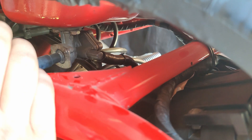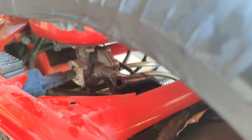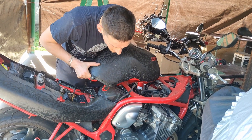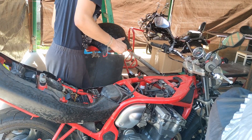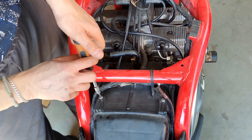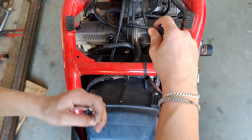Okay, took down the vacuum hose. Now let's take down the gasoline line — hopefully it will not spill tons of gasoline. Hopefully that works like a closing valve. Oh yeah, no spillage! I also took down the hose from this side as well. I prefer to do this instead of just pulling it out from the frame — seems pretty tidy. Undo these two Phillips heads holding the air box and hopefully we'll gain access to the air filter located right behind here.